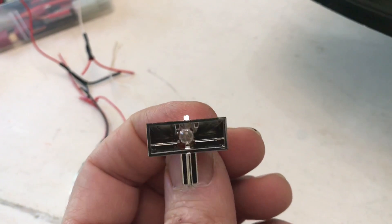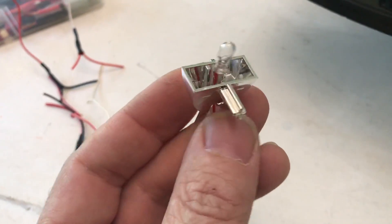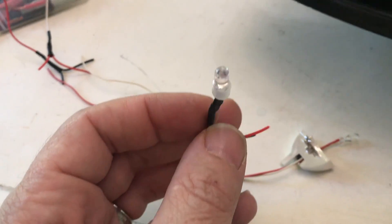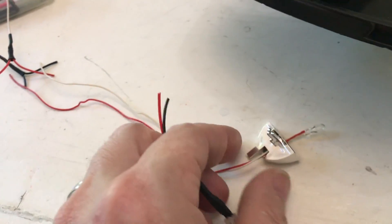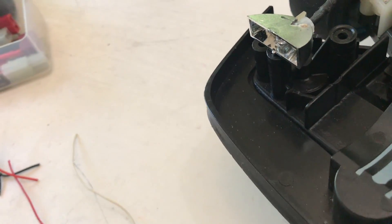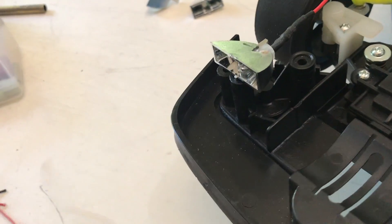What I'm going to do now is modify the front headlights from this low power, cheesy braided LED bulb. You get these off eBay for like a buck 89 — they give more of a blue tint, but they're still better than the original and they don't use hardly any power. I already got one inserted. You do have to make your opening a little larger in the back to slide the LED through and then just hot glue it and you're good to go.